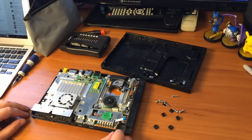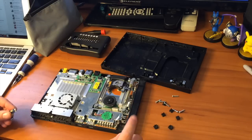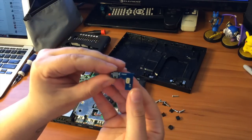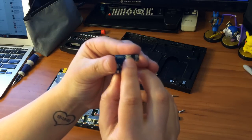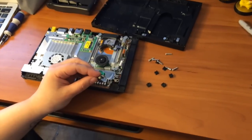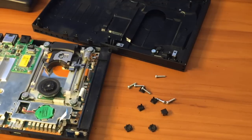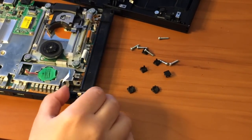What you're going to focus on is this little piece here. This ribbon comes out — if you destroyed it you just yank it out and stick the replacement in, but my ribbon cable stayed in decent shape, it was just this piece. So you're going to take your little power piece here. This is where you're going to be plugging the ribbon into on the other end, and this is your power button right here. Make sure this is facing the front. Right about here is where you're going to place the power button — it'll fit really nicely into the grooves, just like this.